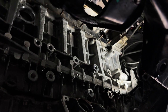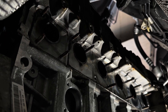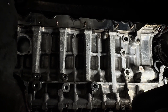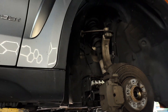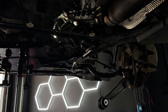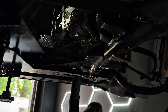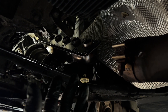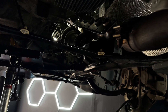You're staring at the empty space where the turbo used to be with a shiny new turbo in your hands — let's make sure this installation goes much smoother. First, get your surface spotless; you didn't go through all that pain just to have a tiny piece left behind cause a massive exhaust leak. Do a sanity check: place your new and old turbo side by side to make sure you received the right part. You have to install it from under the subframe — there's no way to get it in through the exhaust side. Don't even try it.